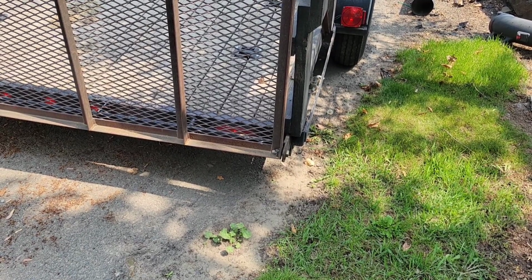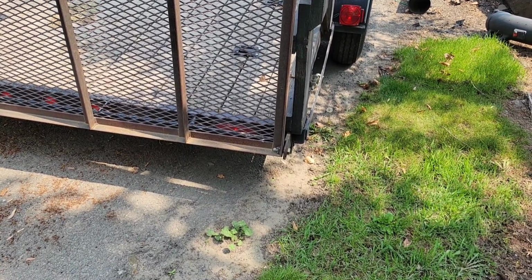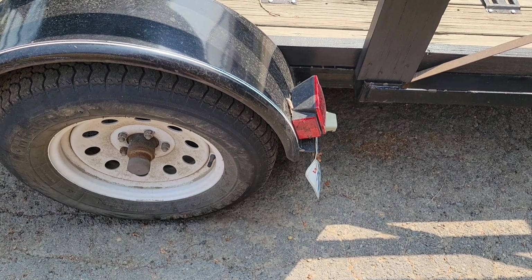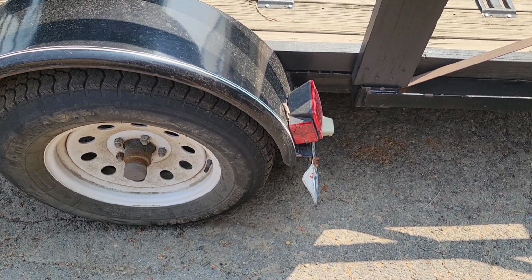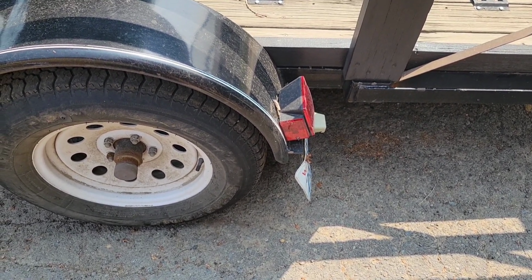It's probably just all those wires put together. There's probably a bad ground connection. So I need to clean all those connectors. I don't know if this light is causing my entire problem, but the fact that it's not doing what it's supposed to, it is a problem, needs to be fixed. I suspect it has something to do with grounding. So we're gonna remove it.